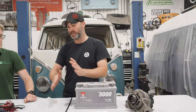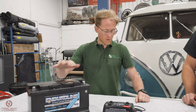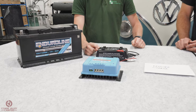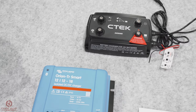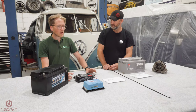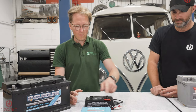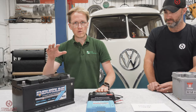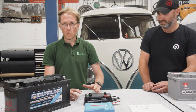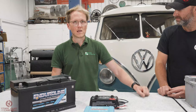We have a line dividing the vehicle side and the camper van leisure electrics side. On the vehicle side we have the alternator — in particular a smart alternator. The battery to battery charger takes the charge from your alternator via your van battery, smooths out the variable voltage that the alternator gives you, charges the leisure battery, and when the engine is turned off separates the two batteries so you won't flatten your main van battery.